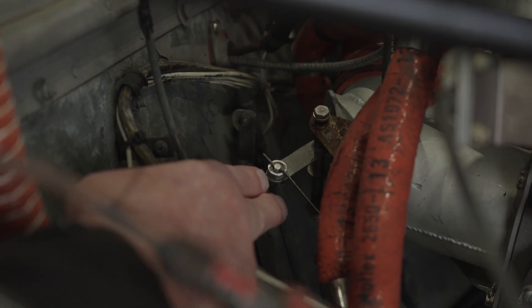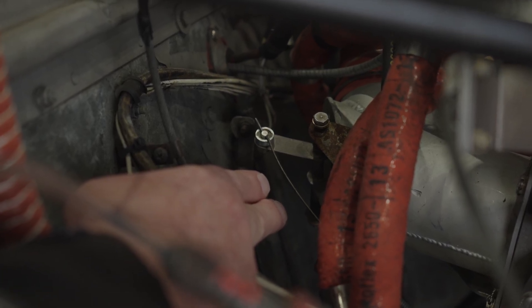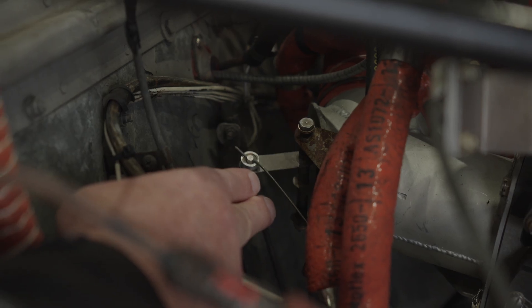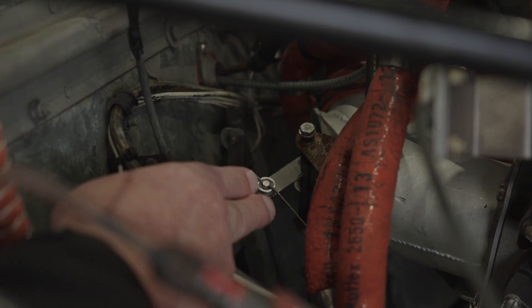It's undoubtedly warmer than the outside. The alternate air is open. Tim's going to go ahead and close it now. The alternate air is closed, and that would be the normal position. We start losing RPM or manifold pressure, a combination thereof, due to ice. He's going to go ahead and open it up, and that would bring the engine back to life and get us the air that we need to breathe.